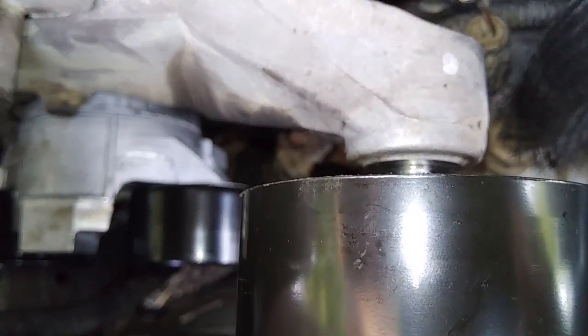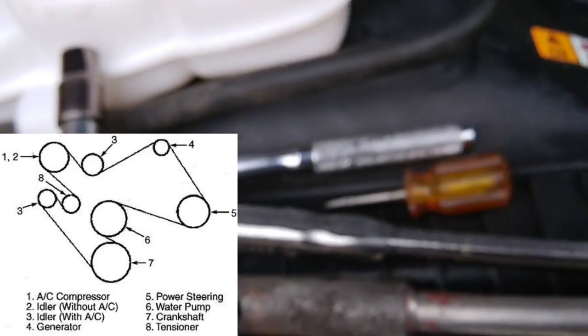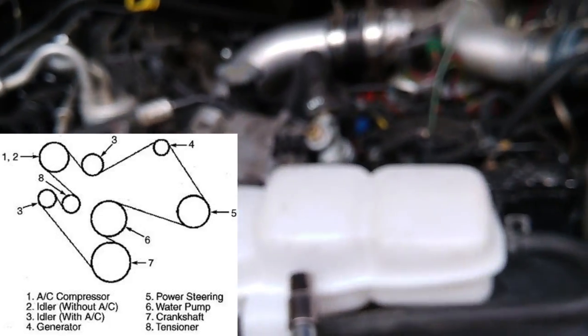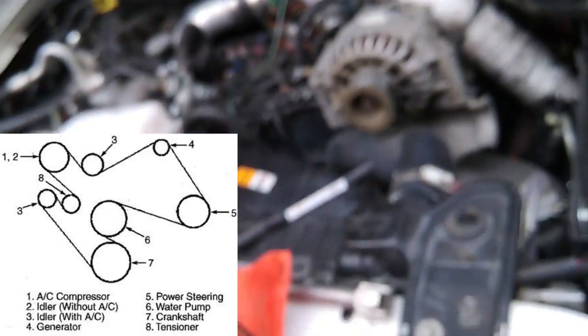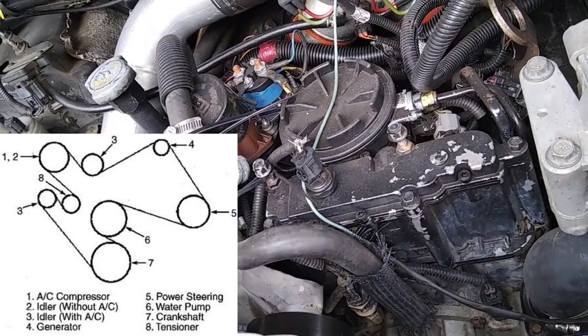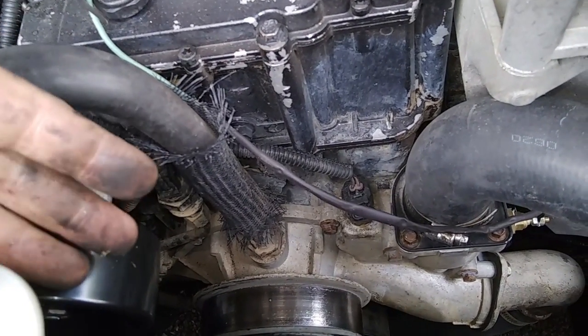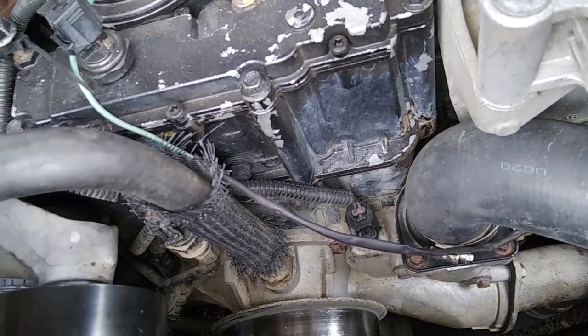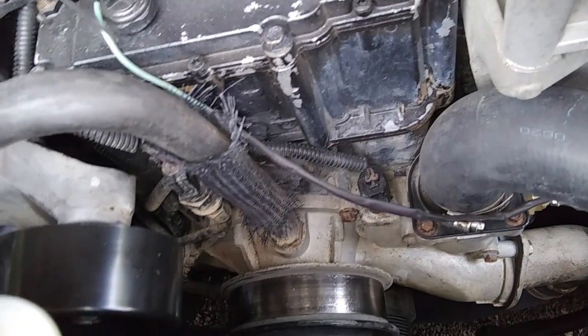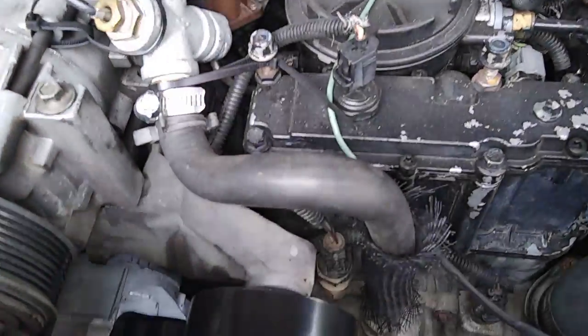You can see it's in there now. I went ahead and tightened down the tensioner and I just need to tighten down the upper pulley now. Once I get the pulley tightened, I just need to route the belt. I have a diagram and I'll show you guys a picture of the belt routing diagram on the screen now so you have it if you don't have one. It's not too complicated. The most important thing to remember is that the upper idler here is the last little part you want to do — you get everything else done and then that part right there is the last one you push down, because it's the easiest to get to.